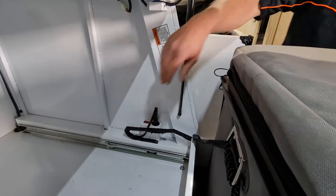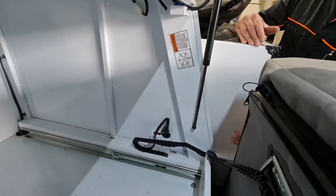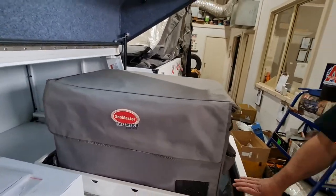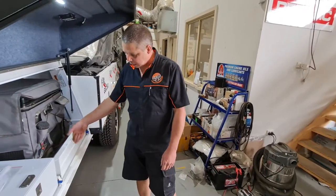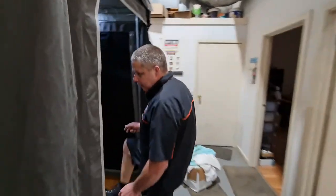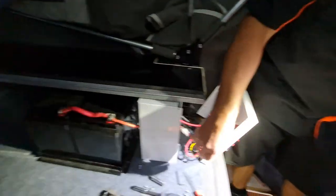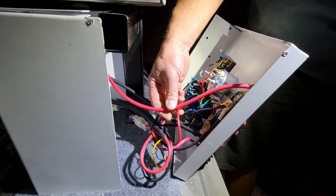The big mod with these is that the wiring to the fridge is very, very small. Underneath this box, which we're going to remove, is very small wiring. This Snowmaster fridge-freezer combo has a maximum rating of around 5 amps. We've had the whole unit apart and measured the wiring at the plug inside off the switch. We've actually already done some upgrades to the wires here — the original wires were very, very small, and we've upgraded to a much larger gauge, as you can see the massive difference.